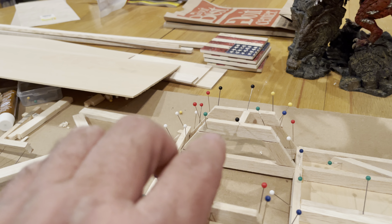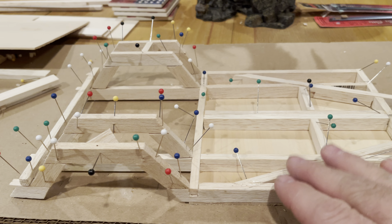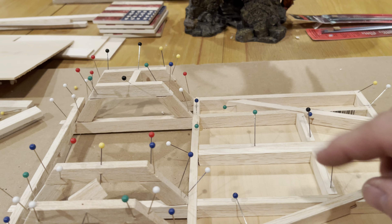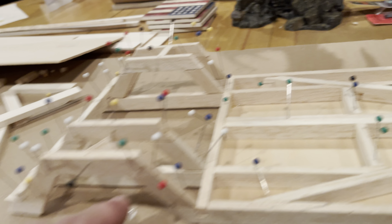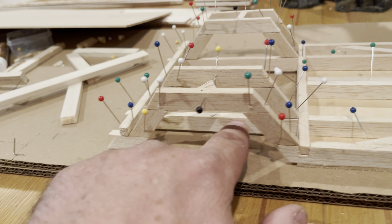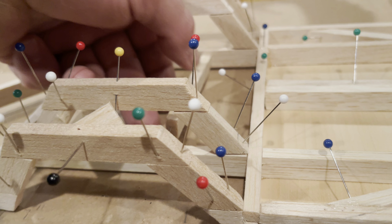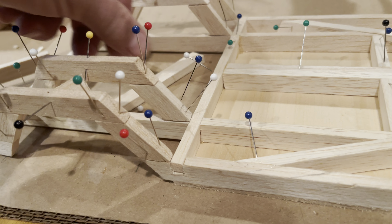Water tanks will be underneath, and I have a small holding tank in here. I'm going to insulate all of this. The actual body is going to be fiberglass that sits on top, with about six or eight mounting points using half-inch rubber grommets so it doesn't shake. There's no room for an axle to go through as-is, so I'm putting a timbren axle with suspension on it, which means I have to add more support across this way.